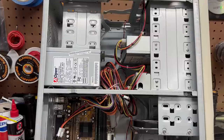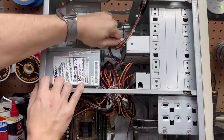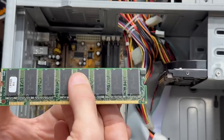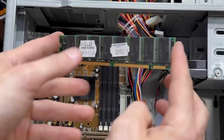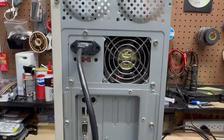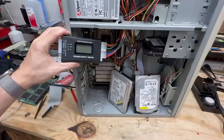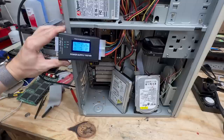Let's go ahead and disconnect all power. Let's have a look at that RAM — we got 128 megs, no indication of speed. This looks like a very similar stick with no indication of size on this module at all. I'm going to clean up the edge connectors and get this RAM back installed. Right at face level — here we go. The lights in the shop went dim for just a millisecond. Power supply tester is not happy about it — looks like we got some pretty wacky voltages. Let's connect a couple of sacrificial hard drives and see if that changes with any load. Both look a little better. I guess I can trust this power supply.